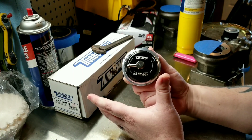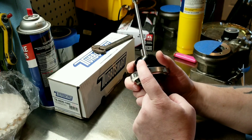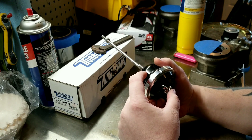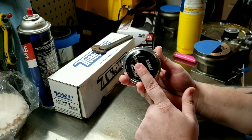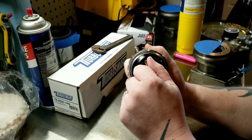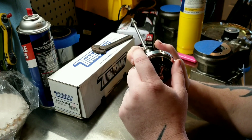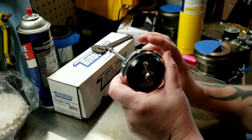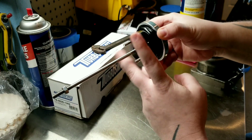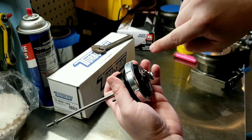There are three types: one where the nipple is on top, one where it comes out the side, and one that has both — in case you need differentiating pressure between top and bottom to actuate it. The top-style nipple is simple; it rotates whichever direction you need so you can index it toward wherever the feed line goes. The side nipple is more difficult because you have to figure out bracket placement and modify your bracket to whichever direction you need.